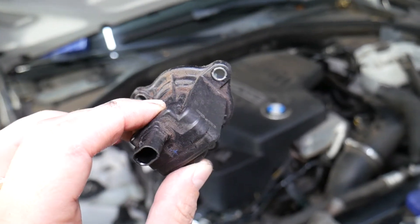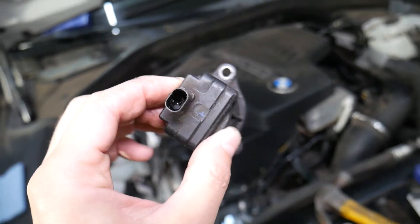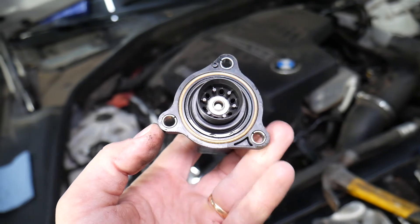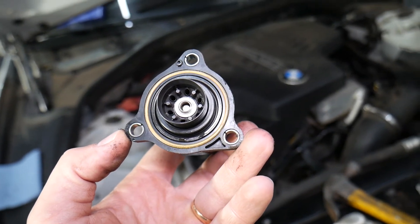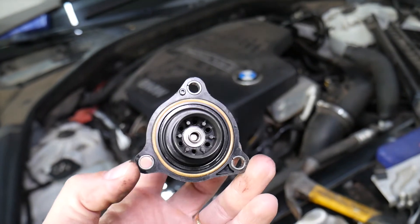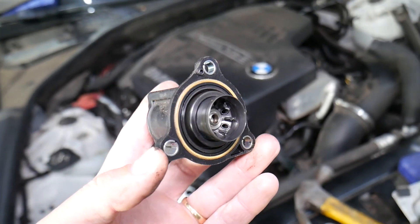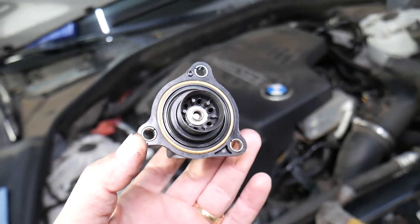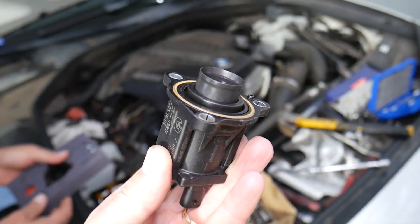You can see that's the diverter on a BMW N20 engine, used in multiple BMW models. It has just two wires. If you notice a code - I'll have a special video about the code, but I think it was a boost leak or something like that. Usually you notice it if you drive in eco mode or if the vehicle shifts at lower RPMs. If you drive it hard it doesn't happen as much. It's very likely you have a bad diverter.